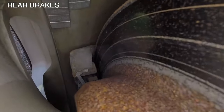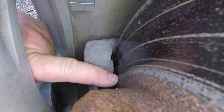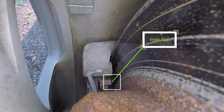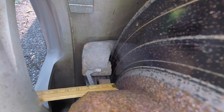There we see it a little bit better. It is like a little metal spring — a flat piece. When the pad wears down, this little metal piece is going to touch the rotor and then it will squeal. This one has a gap of 5mm on the rear brake, so we have 5mm left before it makes that noise.